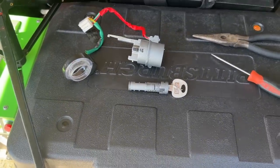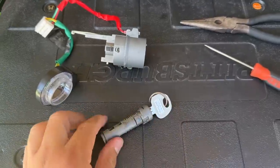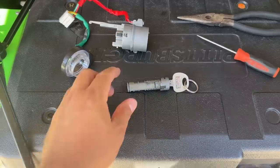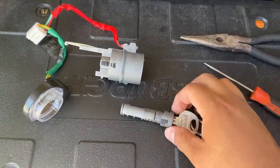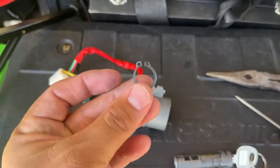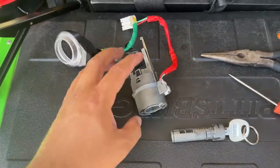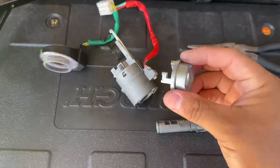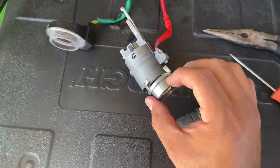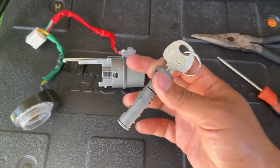Over at the back of my truck, the lock cylinder is already disassembled. This lock cylinder went inside this assembly, and on the back side it was held in with a little snap ring. You also have to pop off a small plastic piece on the front. The other piece is a face plate that goes on the front of the lock cylinder — it just twists on, so you twist and pull it off, then you can pull the lock cylinder out.